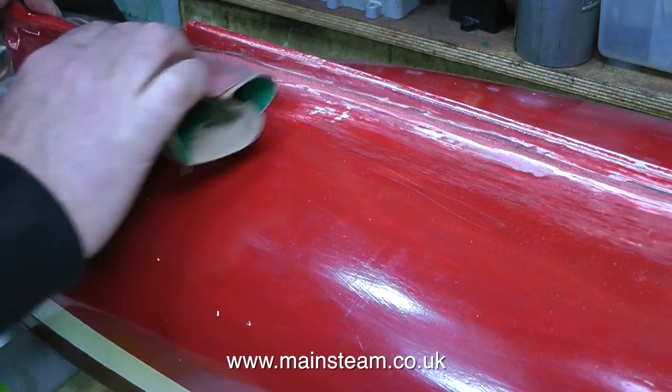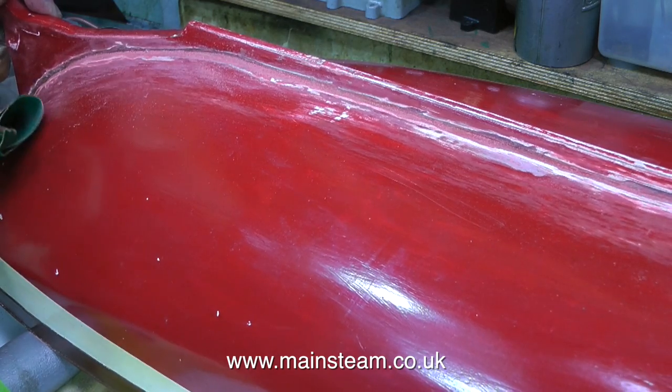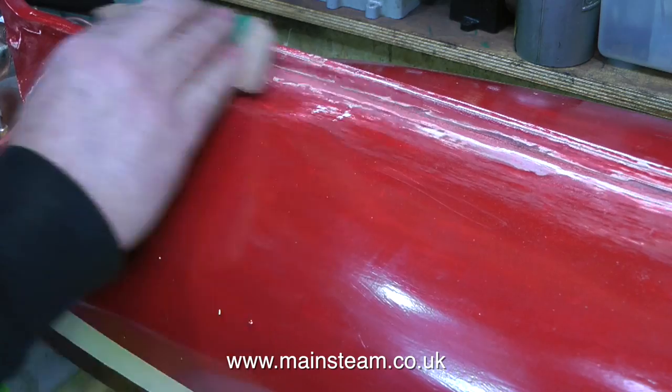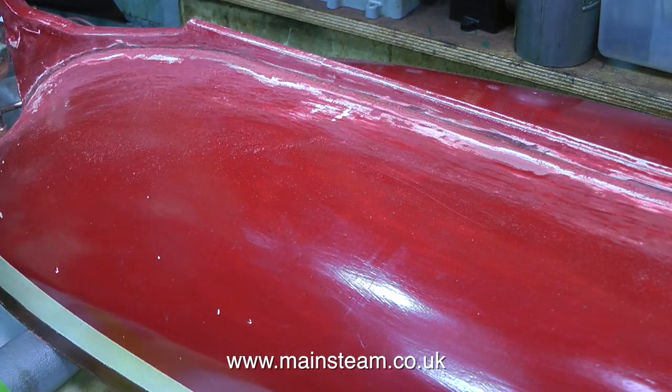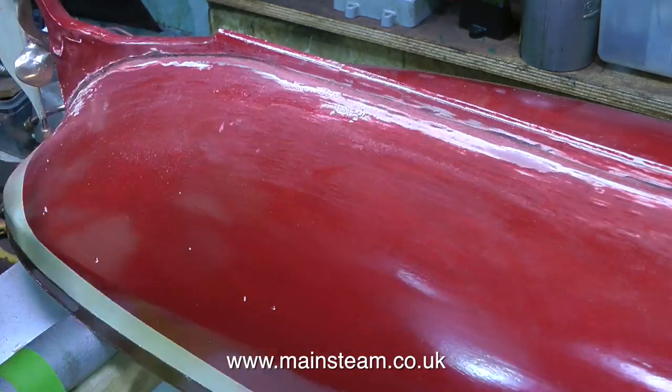The original red paint on this hull was put over the top of the creamy coloured paint, and as I'm rubbing the red paint — as you can see at the moment — the red coat is coming away from the cream coat a little too easily because it's not very well keyed. That's enough sanding for now; it's time to fill the gap in the keel with some car body filler.